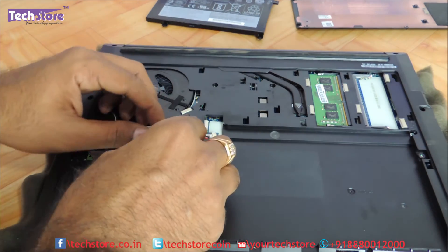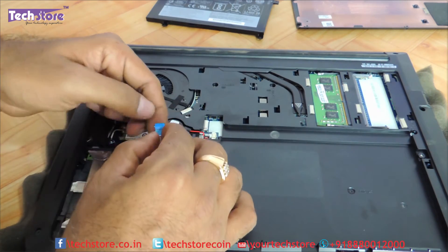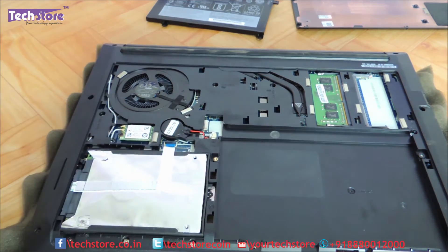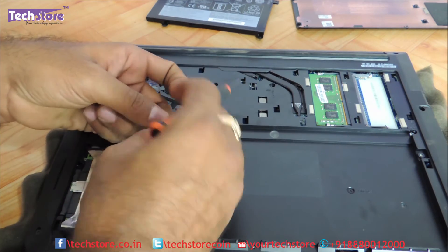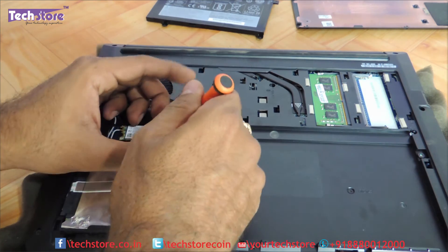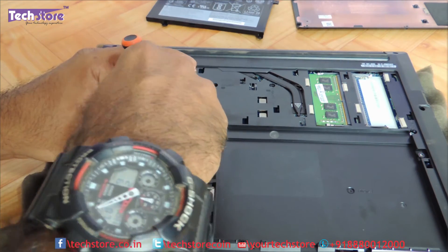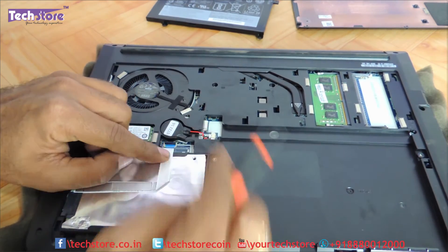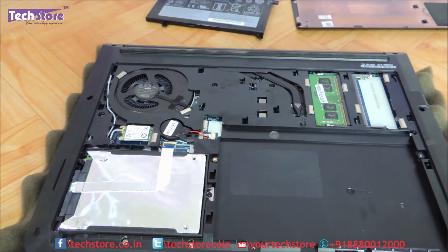And then connect the notch back — something a little flimsy with many laptops nowadays. Just need to basically put it inside with this particular glue, and now it is fitted. Just need to close it here and you have upgraded the hard drive of this particular laptop.